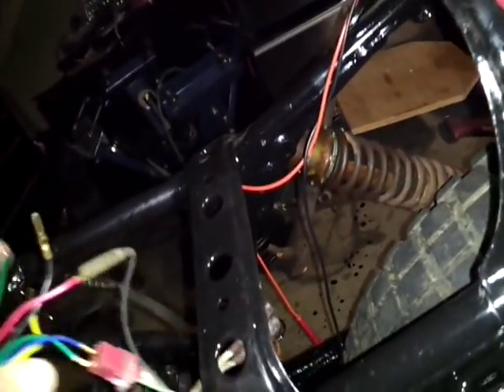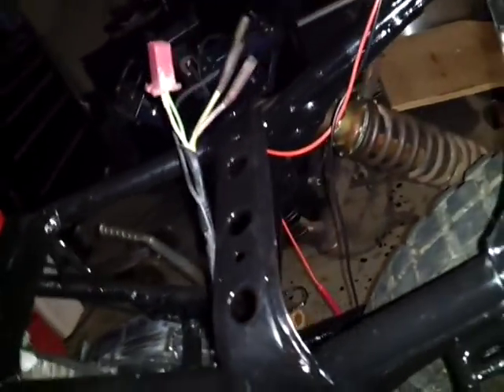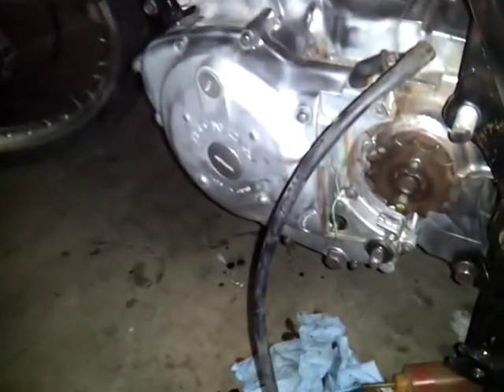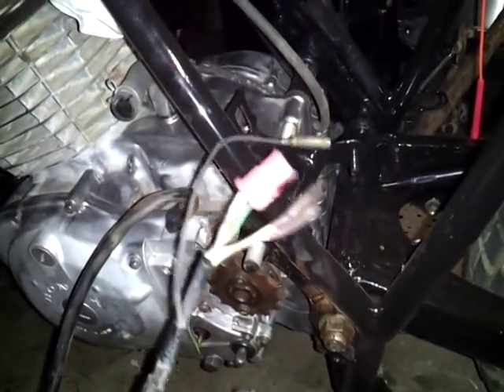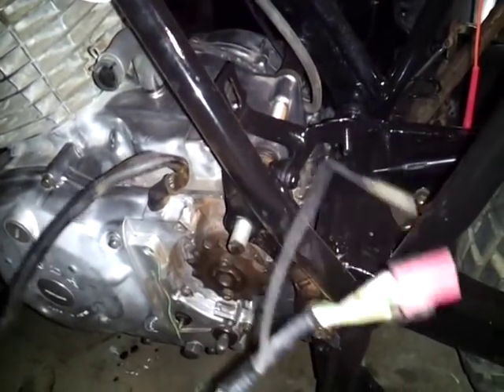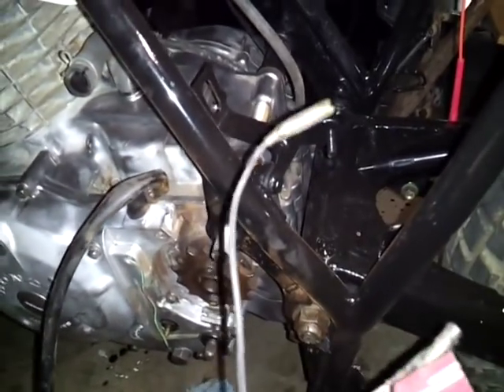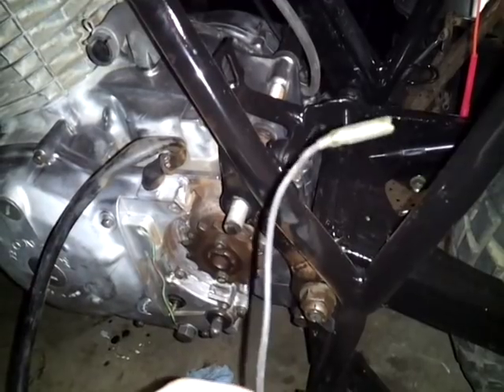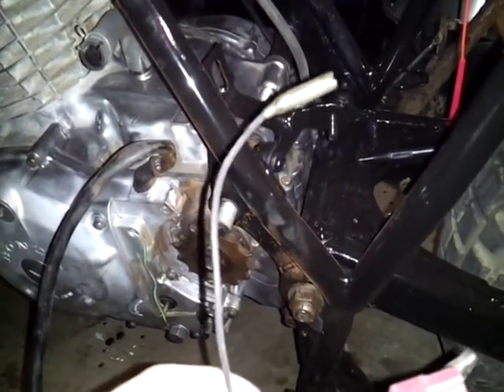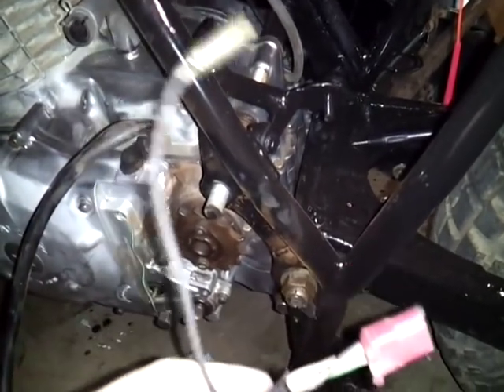As far as the wiring goes, you're going to have a wire that comes out of your motor from your stator. You're going to have two major wires. You're going to have your stator wire that has 30 plus volts going to it, maybe 20 sometimes, but a pretty high voltage of AC current.